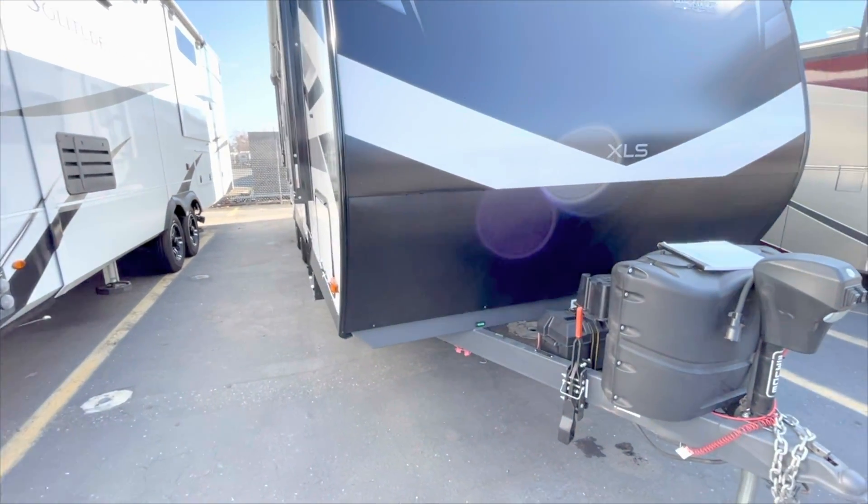There are a lot of items where the silicone has worn off. You can see up close where it was and it's just worn down from age, because this unit is approaching three years old. You can see where the putty tape has bled out. A lot of times when I'm seeing putty that's bled out, it's usually a sign that that molding is moving and walking itself. Keep an eye on that.